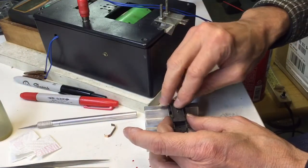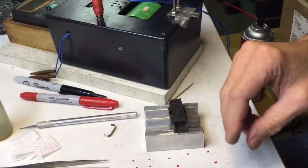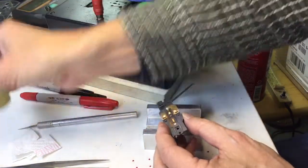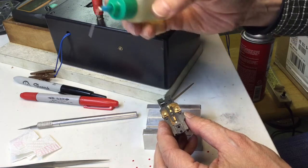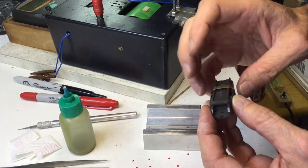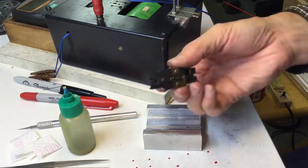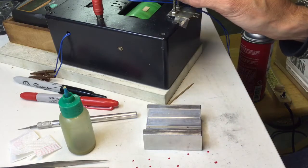Put a little oil on top, put on the clip, and make sure it stays oiled pretty well. Don't worry if you get oil in the motor brushes — just clean them up or replace them. You want to have a lot of oil on here so you can get consistent results and don't dry it out in the middle of the run. I've got this thing at about 19 volts and I'll just spin it up.